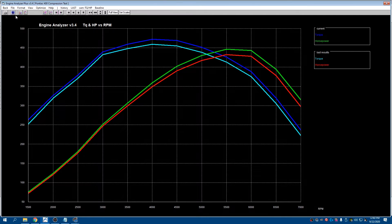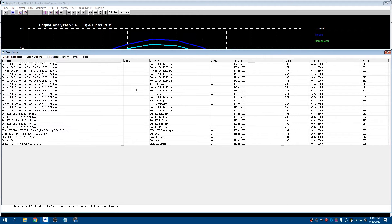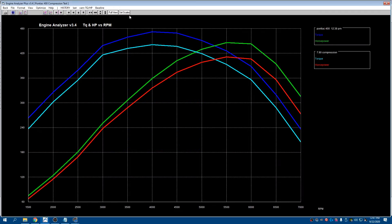Looking at the chart, we see about the same gains just across the board. Under 3,500 RPM, it's not really worth making the changes. Now let's look at the start versus where we ended up: if you're starting at 7.9 to 1 and going to 10, it's worth it. Going from 7.9 to 9, I'd say that's worth it. But going from 9 to 10 — I would say it's not worth the extra expense. You're better off getting a set of 16 heads instead.